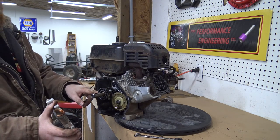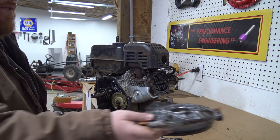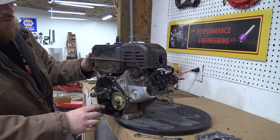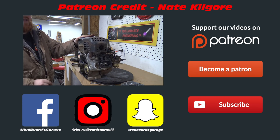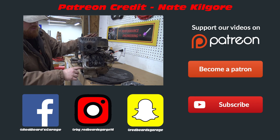I've had this happen to me on a few engines. The bearing can get seized on the shaft. It's no big deal. You can actually leave it on there. The best way to avoid this is to sand your crankshaft before removing it. That is strange. This is the first Predator non-Hemi I've had, and it has a plastic cam gear in it. That is very strange to see.